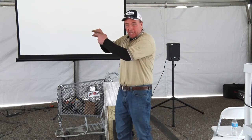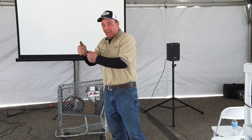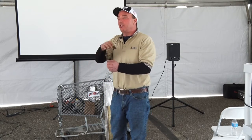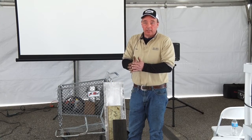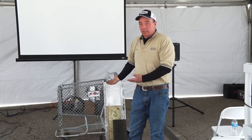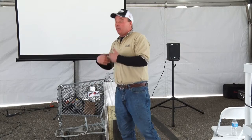Those little numbers that you see, if you have the numbers, that is not a true tell. Don't set it thinking, oh, I know if I have one horse, I set it at 3. No, that gives you the range of where you want to be, and then you adjust it in. Okay, so it's real critical that you make sure that you do that, or you'll end up buying yourself brake shoes.